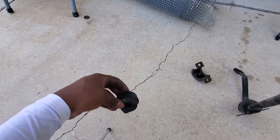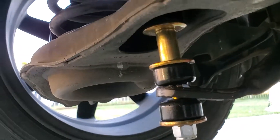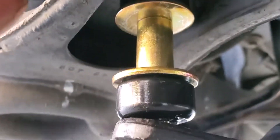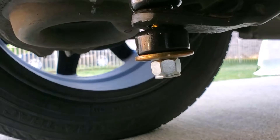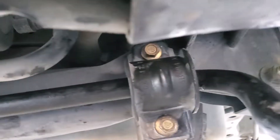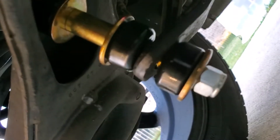Anyway, let's put this together and start reinstallation. Here's how it's supposed to look: you need washer, rubber piece, rubber piece under the bottom, washer, spacer, spacer, washer, rubber piece, rubber piece — press those two down — then washer, then nut. That's how the link is supposed to go. For the sway bar bushings I'll tighten them to spec — I believe 56 foot-pounds. For the links, you just want to torque them evenly; you don't want these to compress too much, and when they start compressing, stop — you're done.